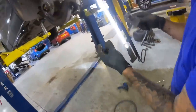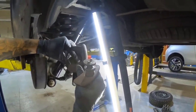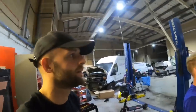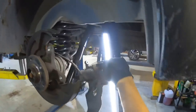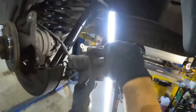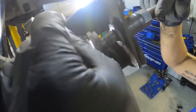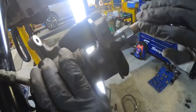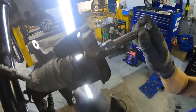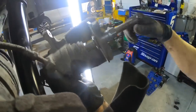You need a wind-back tool to wind the piston back on the caliper. That bit slots in there - you push it back to compress the piston. You need a wind-back tool, and then you can slide your pad in. Because if you try to fit it without that it won't fit. This is just the wind-back tool to get the piston back in the caliper - you tighten that up and push it back so that it goes against there, getting the pressure to push the piston back.